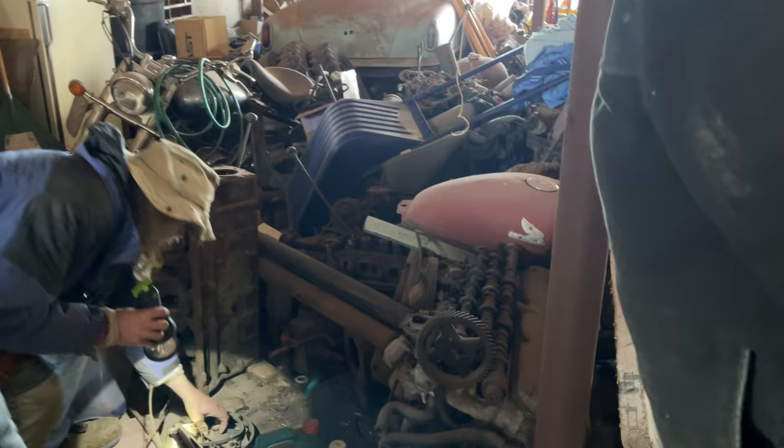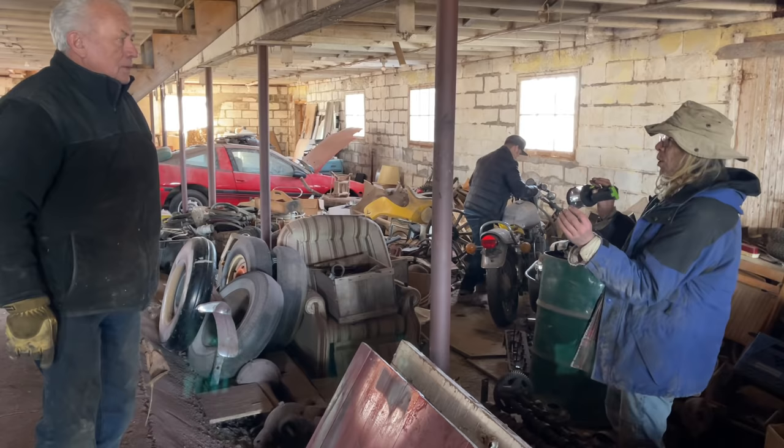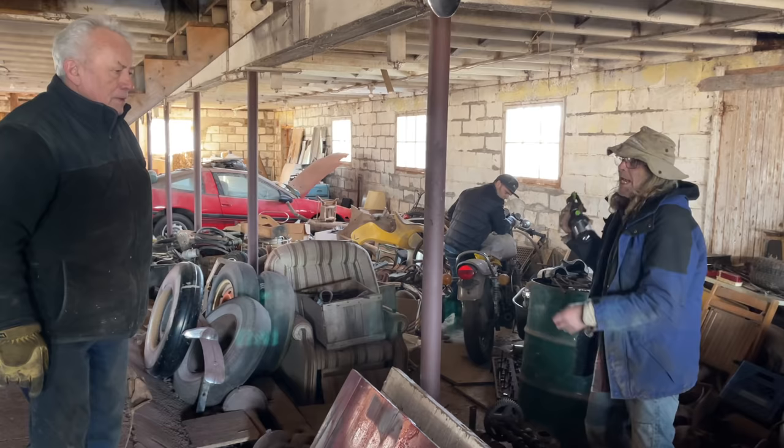Yeah, that's all Hudson stuff there. That's the original emergency brake combo. When you put the brake pedal on, the emergency brake pulled. So I put three-quarter-ton 1978 Chev cables on, modified, and then I put a cable hookup in the center, so one cable pulled two cables. And the attachments went into the hub the original way. It works, and it saved hundreds of dollars. But I didn't put that back on. There's the manifold for it, that 600.